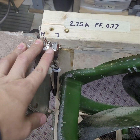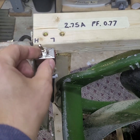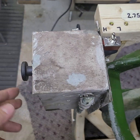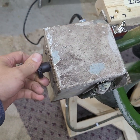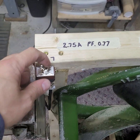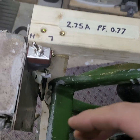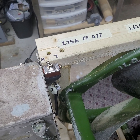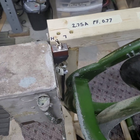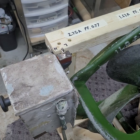You could actually use a different switch that has three poles and three positions, so that one position is off, then you'd have a high and a low. I didn't do that with this because it has the converter, so I already have an on and off. But if you tried using a double pole switch with a middle off position, what's going to happen is it never disconnects the start windings. Even though the fan won't run, it'll still be energizing the start windings and it'll burn your motor up. So you really need to use the right kind of switch for how it's wired.